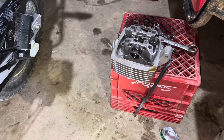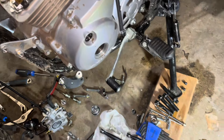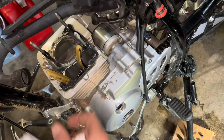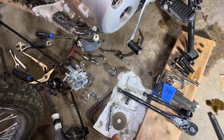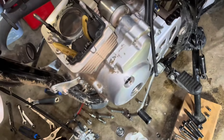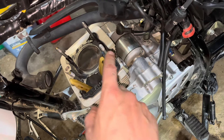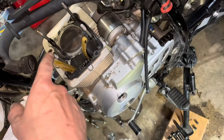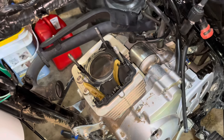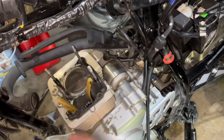There's the cylinder head. I used the big socket to hold it and the little 8mm wrench to take off the cam gear — there's the cam gear, with all the rockers and camshaft still in the head. That allowed me to slacken off the chain. There are two little bolts and four big ones that thread onto studs, and with a little wiggle it came out, though it was a bit tight past the exhaust stud and the bracket at the top.